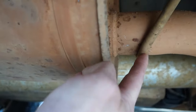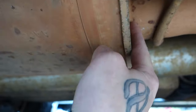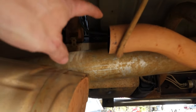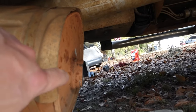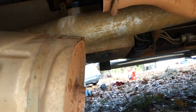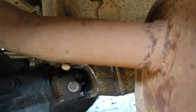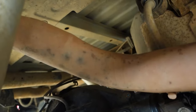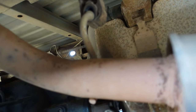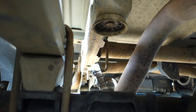What we're going to do is leave this hanger right here and just cut it right here. You could probably cut this and put a little turn down and be done if you just wanted to run converters with no muffler, which from my experience actually makes for a decent sounding vehicle. So we got the cut right there. You're probably better off cutting from the bottom up — if you cut from the top down it ends up pinching the blade and it turns into a nightmare. Or at least put a jack under it or support it. I'm going to cut as close to the muffler on the back side as I can so I can save the exhaust pipes, maybe use them when I'm deleting the cats. And I'm going to cut the metal hanger as close to the pipe as I can, because I'm putting the muffler back on this thing.